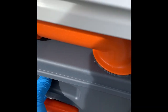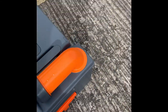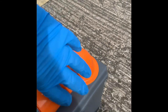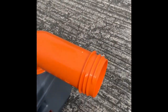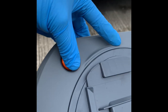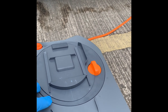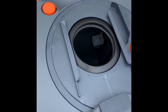The cassette is removed by lifting this handle and pulling towards you. Take that out — this handle is telescopic — and it's on wheels for easy transportation towards the waste area. To empty the toxic fluid: the funnel goes forward, take the cap off, put it somewhere safe — you don't want that falling down the disposal area — tip forward, then press this orange button to release any airlock, which helps everything flow out nicely. To rinse out the cassette, slide this back, open the top, and with the hose go in and out swirling it around.